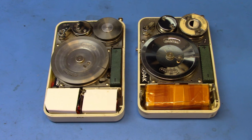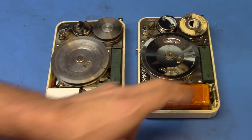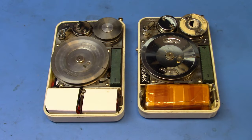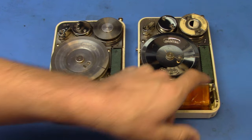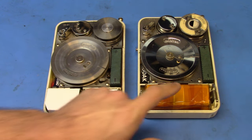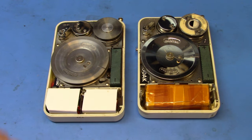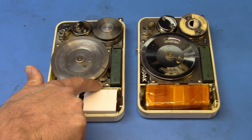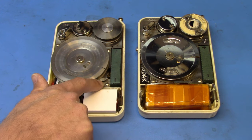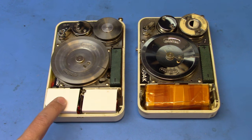The disadvantage of the updated design was twofold: you no longer had variable speed — on the original you could run at lower speed for more recording time, but the new one is one fixed speed. Also, electrical noise from the electromechanical governor is fed into the amplifier. The Monsk does not have as much electrical noise from the motor, but the Protona has more stable speed. I very rarely find pictures online of another Monsk Minifon with the speed controller, leading me to think this is not only much earlier but also much more rare.